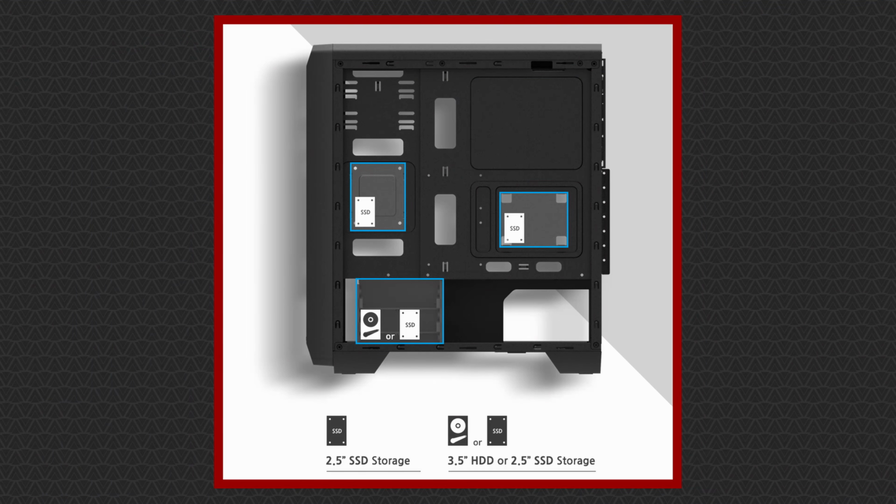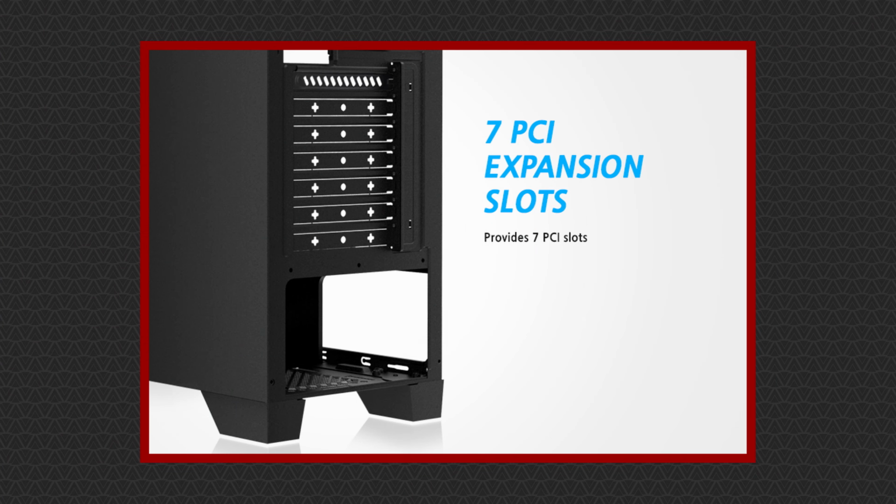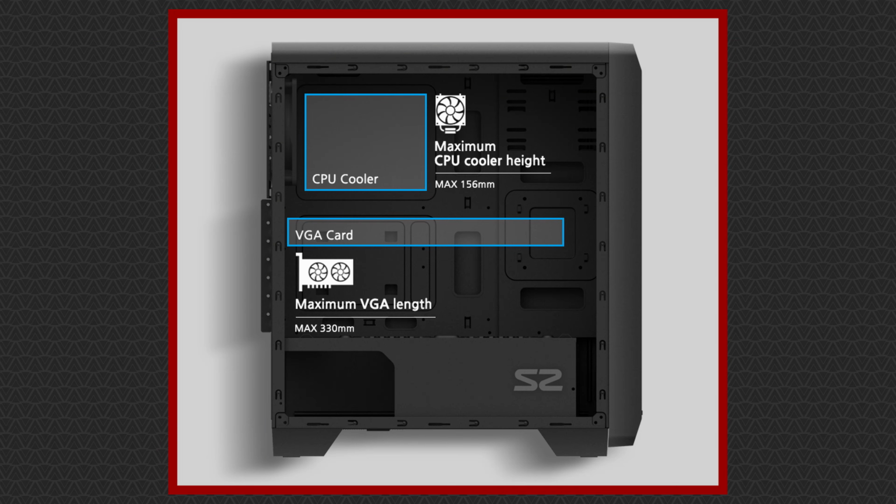Drive support is a touch better in this case, back up to 2 3.5-inch and 2 2.5-inch drives, but the radiator support has dropped even further down to a mere 2 120mm radiators. That's official. I'm sure you could try and squeeze a 240 up front. For a 35-litre case, that's pretty stingy. The PCI Express section is a bit tighter on this one with 7 slots, which is fine, and 330mm of depth clearance, which is getting towards a little tight for longer cards.